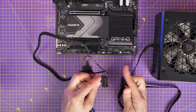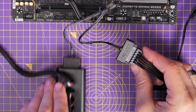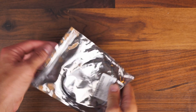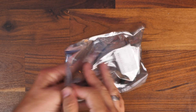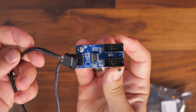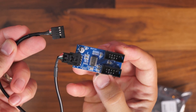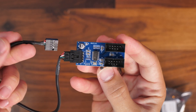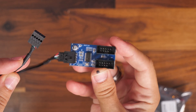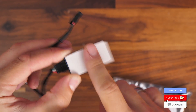This is an essential purchase for most builds, especially if you're running loads of RGB. There are alternatives — I previously recommended a smaller, more affordable one with only two ports that connects two USB connections into one header port. It doesn't require SATA power, and has a sticky back so you can mount it in the case easily. You can also, if you're brave, take the cables apart and thread two USBs into one header yourself — but I prefer the easy solution.